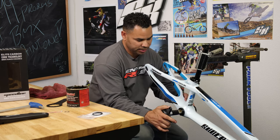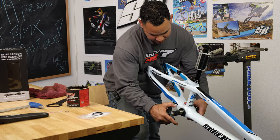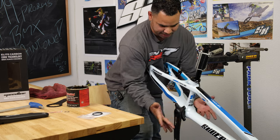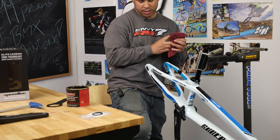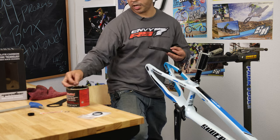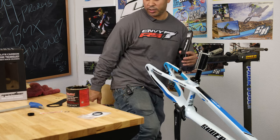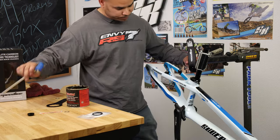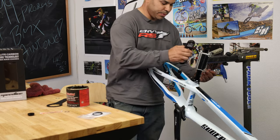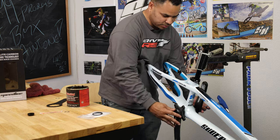We're just going to slide it directly into the frame. This can sometimes be a little bit tricky, especially with a new set of cranks because they're not worn, but you can always just pop it in there. I always say just get open-handed like that — this one's pretty much slid all the way, just pop it on the end and get it nice and through. This is one of the quicker installs because there's just really not too much going on. We will go over bottom bracket spacers in just a second. But once we get this last one on, all the Allen wrenches are going to be this exact same size. People usually have this size already in their toolbox — it's a pretty standard size used in the BMX world. You're going to slide it right onto the crank arm and then just go ahead and thread it on.